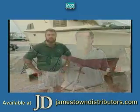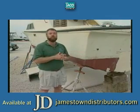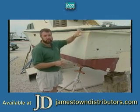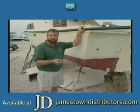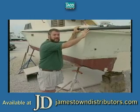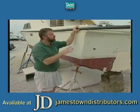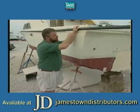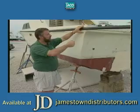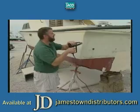Now we're ready to install this 20-foot length. Installing rigid vinyl on your boat is pretty similar to the aluminum in the way that Taco has drilled out every six inches — that's where you mount it — but making turns and bends is a little bit different. What you need to do is excite the molecules with some heat. We've got a heat gun to do this, but one thing to warn you about is when you're using a heat gun, you don't want to stay in one area for too long. You want to move it back and forth. If you stay in an area too long, you can damage your gel coat, your fiberglass, or your rub rail.